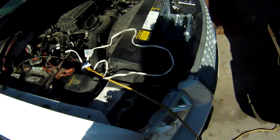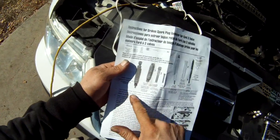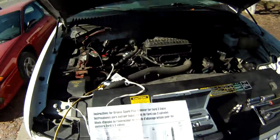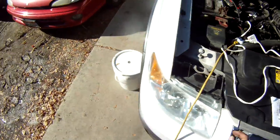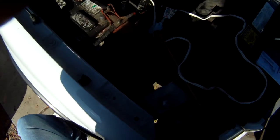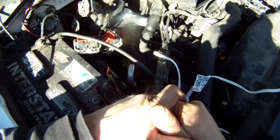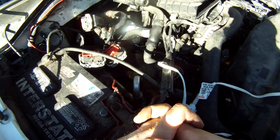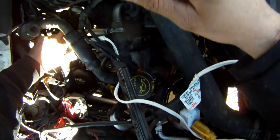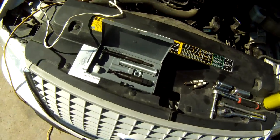Part of the instructions — and if you live up north like I do I greatly recommend it — is to use a heat gun or hair dryer to heat up the broken plug. A heat gun is a little risky to stick down in there, but a hair dryer is not going to get hot enough to cause any damage to rubber pieces or electrical connections. It'll get warm enough to heat up that metal. I've actually had this hair dryer sitting on here for about 20 minutes already.